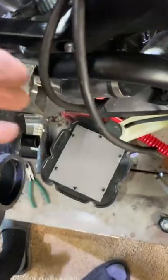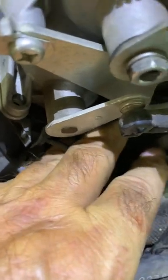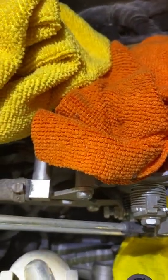Here are two hoses that I've used before when I was synchronizing carbs. I've come around with the throttle body cable and found the sync ports on the rear and the front. Once you see the butterflies, follow the center of that butterfly down and you're going to see one cable plugged on top, and right underneath it is the port you're looking for. Follow the center down till you find the first line, and look right up under it — there'll be a cap. They're capped off.